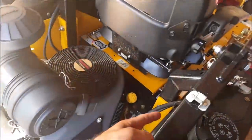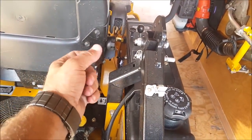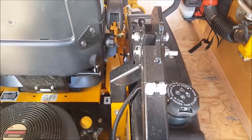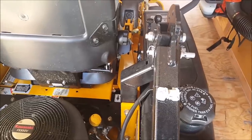It's very simple. The light has a ground underneath it that I used self-tapping screws to attach to the frame. It runs up underneath the bar, goes into that little switch — I drilled a hole and put a self-tightening switch in there — and then ran a line to the battery. It's very simple. I'm no electrician. It took me about 20 minutes.